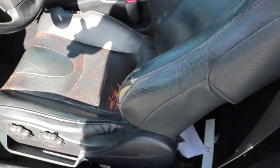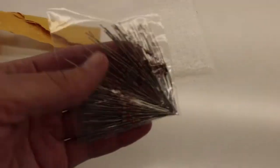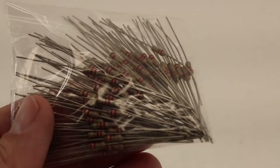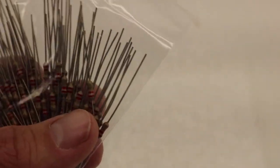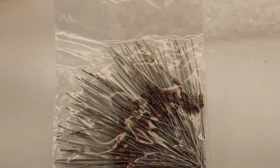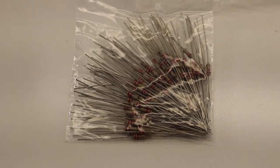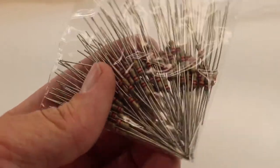You also want to remove all the bolts before disconnecting the battery, because once the battery is disconnected you won't be able to move the seat forward or backward electrically. Now, here are the airbag resistors — I didn't need a hundred but ordered a bunch. These have two red lines and two gold lines: they're 2.2 ohm, one-quarter watt (0.25W) resistors. That's the required spec — you can use quarter-watt or half-watt. She also has a bad clock spring that's already triggering the airbag light, which is a common issue on 350Zs, so we'll need to address that separately.